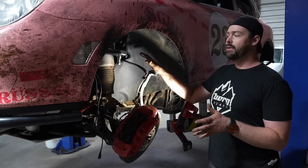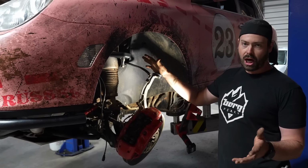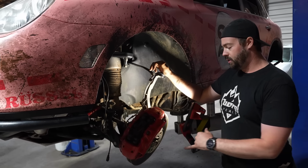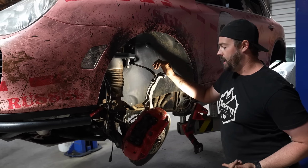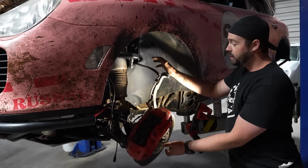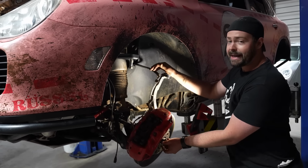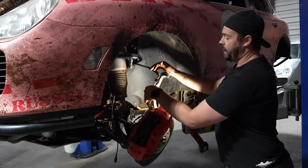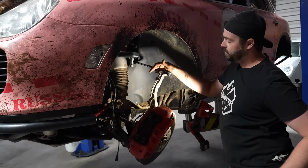So we're pulling out the front shocks of this car, strut shocks, air struts out of this vehicle right now. Couple tips that I like to do: I'll loosen this axle nut and actually push the CV in. I'll eventually take this off completely when I'm disassembling that, but that gives us more throw out this way, so we're not getting close to the bag itself, like puncturing it or anything. There's a T30 here I take off, and that gives us even more room to swing this whole assembly out, so we can drop this strut a lot easier.